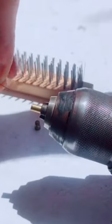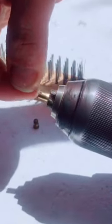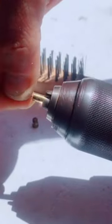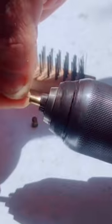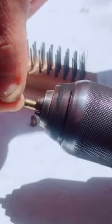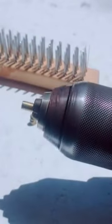Place the little piece of the wire brush in the center, then turn the drill to clean the inside of the little jet. This is one easy way to clean your main jet using just a little wire from the wire brush. By cleaning this, your scooter will work a lot better.